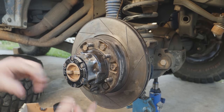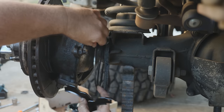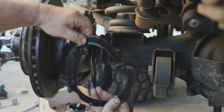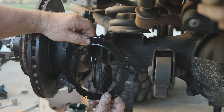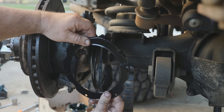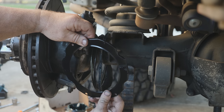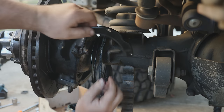Now we'll put the wiper on the back, which usually provides some entertainment. You need to put your steel ring in, then the rubber ring, then the felt wiper, then the two half rings. Make sure when you're putting them together they overlap so they keep each other in. Line it all up — it's not easy going through felt — and tighten it down. You don't need to squash the life out of it, just half an aggadugger will do the job.